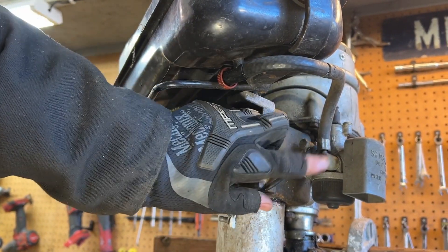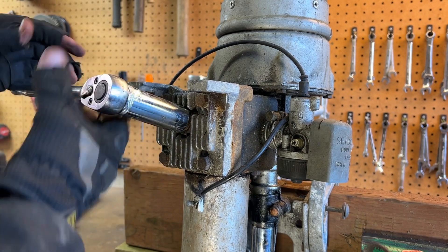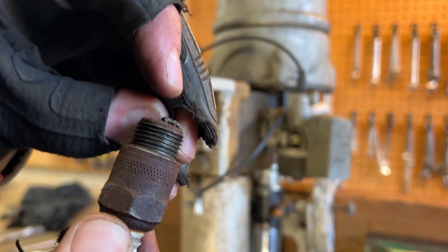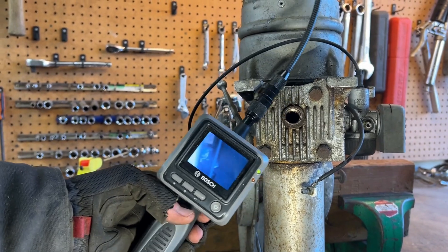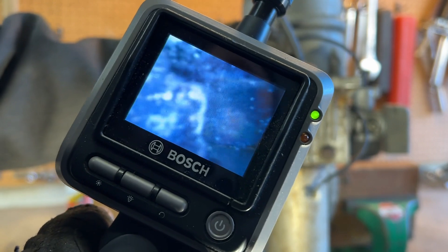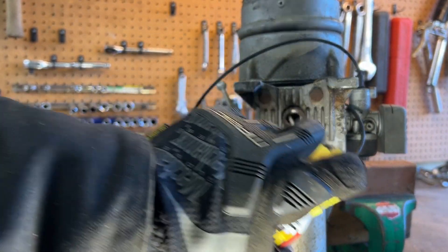Like a banjo bolt - oh look at that, not even tight. It's chalky - sure wasn't going to spark. Completely bridged over and a little bit rusty. See if our borescope can tell us anything. Our piston is pretty high up in the bore - I think that is right there where it's meeting the cylinder wall. Doesn't look great. That's about all we can see. Let's give it the spray of ether anyway, why not.